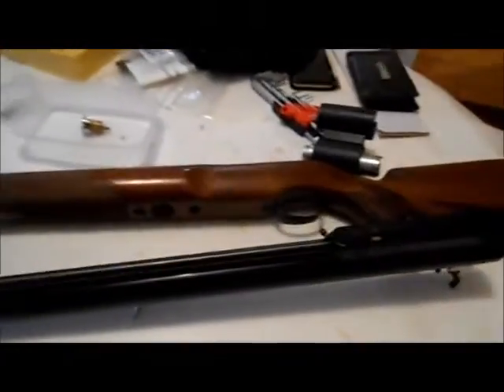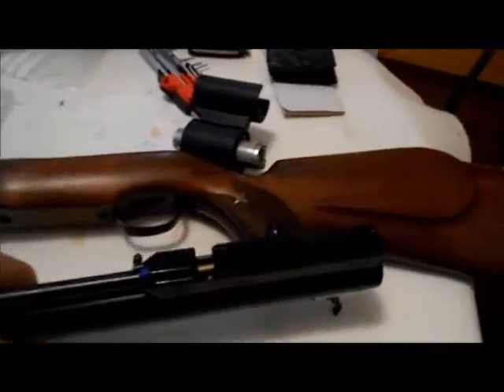Next up, we need to remove the barrel. It's held in place by three bolts — or three elements. One in the end, in there. There's one down here — the gun needs to be cocked — and the mag holder; you can just see that little one in there. The last one is down this end. Take your filler probe out, look down the bottom in there — there's another one, a little nut or allen key, which holds the front of the barrel ring. Once those three are undone, this will all lift off.